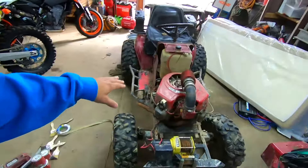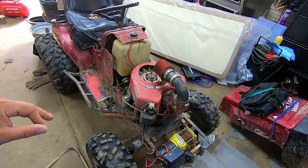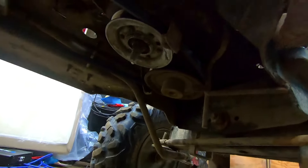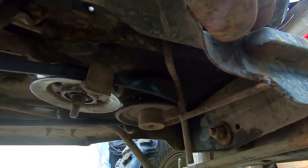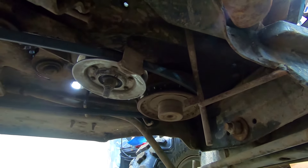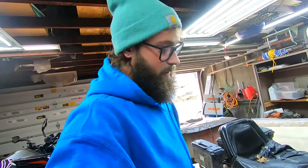The one thing I did have to do is — this flywheel is so light, with this being an off-roader, you've got to rev the piss out of it to get it to move. So I actually have a 4.7 pound crank weight welded to the top of my pulley. It's a solid one inch thick, five inch diameter block of steel. Kind of funny — as soon as I mentioned my crank weight, somebody in the motor community all of a sudden had a five pound crank weight on their big build motor.